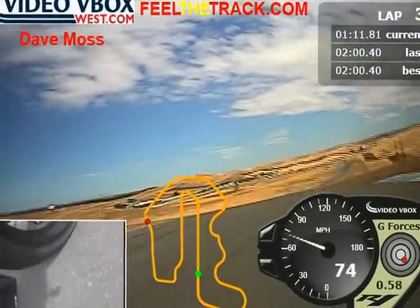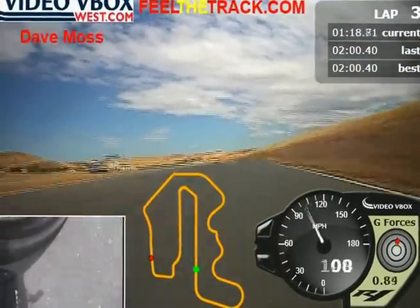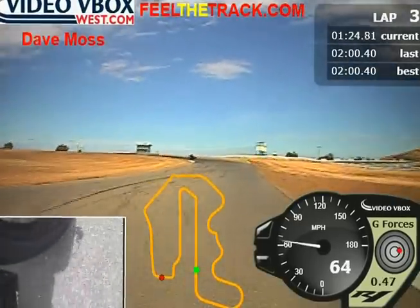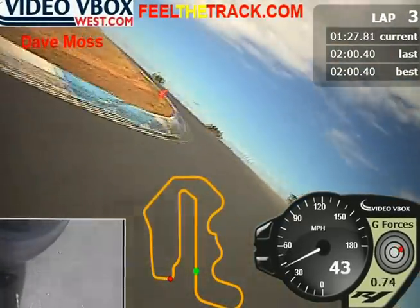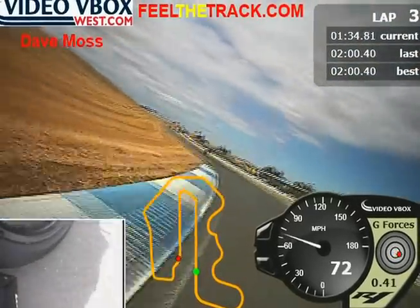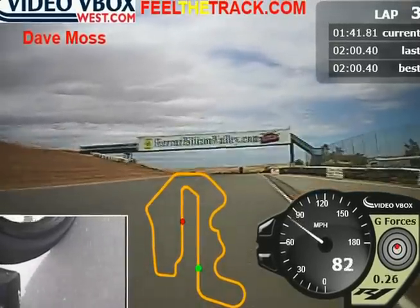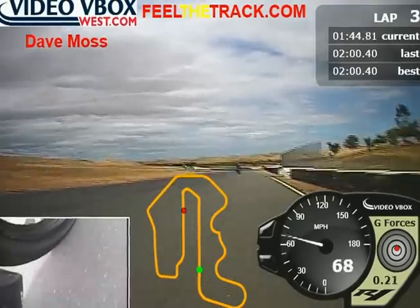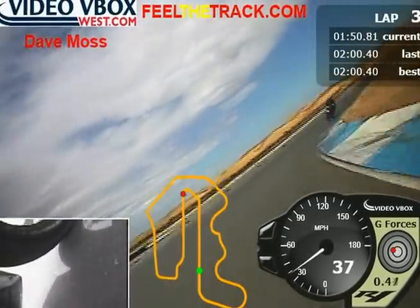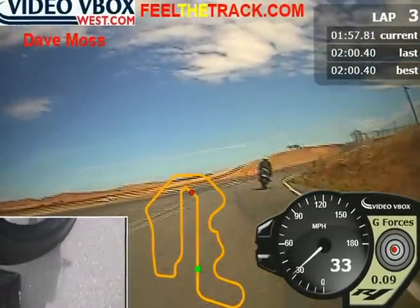I still got to get nine right. That's interesting. Let's go in and take a few minutes to think about what to do with the tire pressure. Geometry is within a millimeter — that's for damn sure. Easier to go down in pressure, so we'll take a PSI out of it later this afternoon and try it again to see how that feels. And as always, look for the full report at feelthetrack.com under the testing program and the Bridgestone V-front.